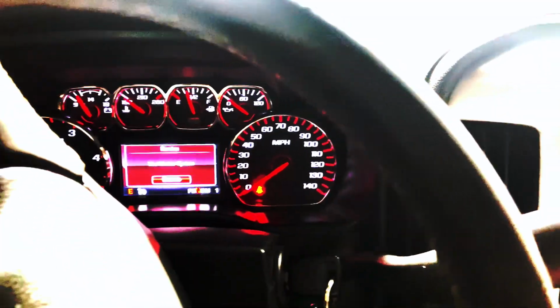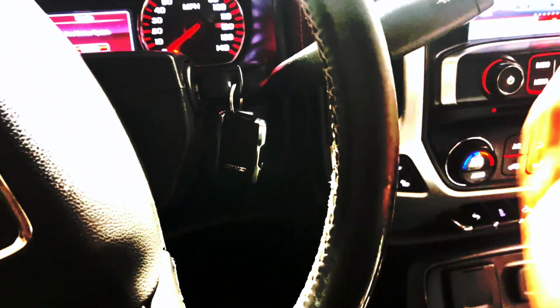Well, since the truck died, it was outside and it was raining. Had to improvise. Tyler's on the scissor lift. Got it hooked to the truck, and the scissor lift actually pulled this truck in here. So now we're just readjusting to get it to go in. But we threw some codes. We threw a low fuel rail pressure code, and also got that. So I think it lost prime. We don't have fuel pressure up there at the rail, but I cracked the filter on the Airdog and I have fuel coming out. So we're gonna check out what's going on with that.